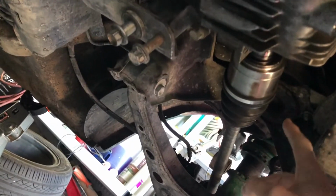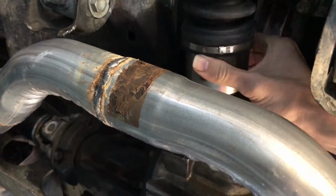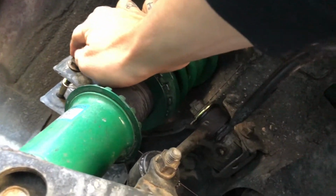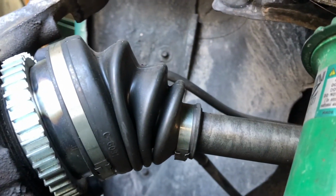But I have that supported by welding wire on both sides, so this axle and that axle both have the same treatment. You can see that wire up there. That hub is undone as well, and they're pulled out. You see that. The reason they're pulled out is as we lower the trans down, this is going to allow the axles to just kind of stay where they are, but they'll angle. See how that's just coming right out there? You see it's binding up right there. Well, it won't be like that. I can put these back up in here, well, actually, I guess I can't since I used the bolt. Whatever though, it'll support the axles enough for us to get this down, and then they won't hang and get all beat up. Having the boot kink like that for a little bit's not going to kill anything.